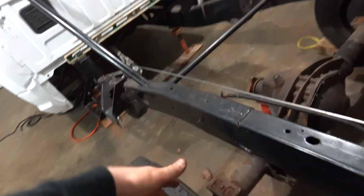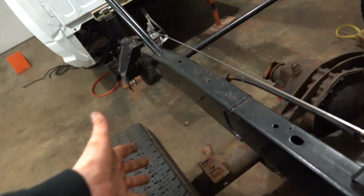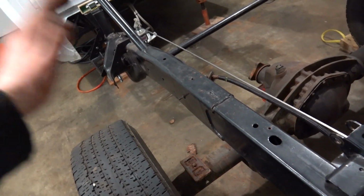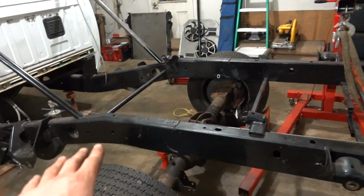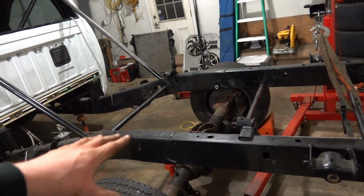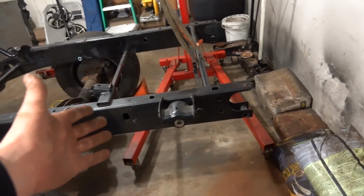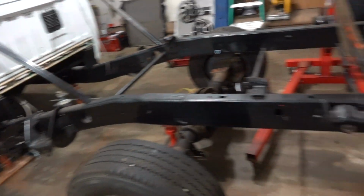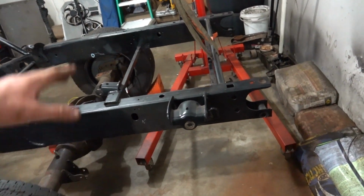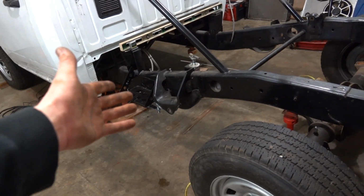I had to cut one U-bolt on either side because the bolts were kind of bound up. My thinking was that I wanted to at least leave one U-bolt loose, so when I came up with the engine hoist, if there was an issue or a problem, I could set it back down on the axle and make sure everything was safe. Once we got it up and got the U-bolts all off, it was just the struggle of getting the bolts out for the leaf springs. The back one we had out previously when we did our drop shackles, and the front one probably has never been out.